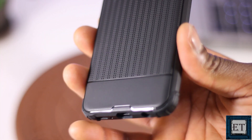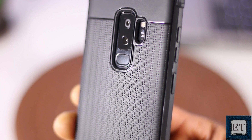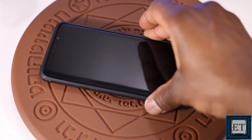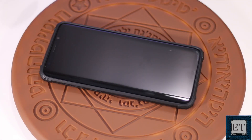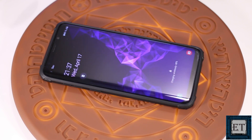My next curiosity was the issue of phone cases — what happens when you have your phone in a case, as most of us do these days. As you can see, I'm using a rubber silicone case on the Samsung Galaxy S9 Plus and it charges up just fine. The manufacturer recommends a distance of no more than five millimeters between the phone and the surface of the wireless charger. It will work well with most phone cases, except if your phone case is made of some kind of metal.